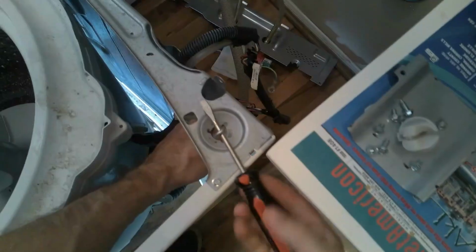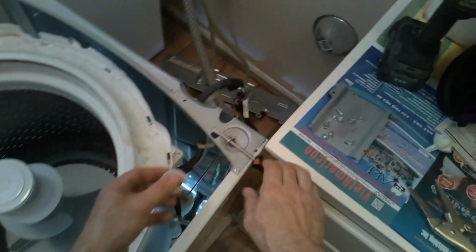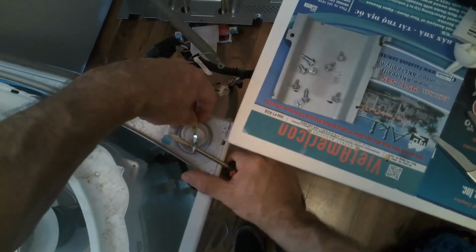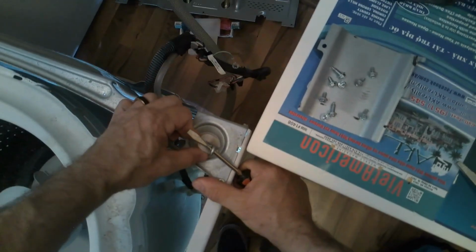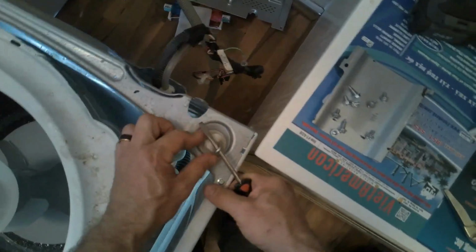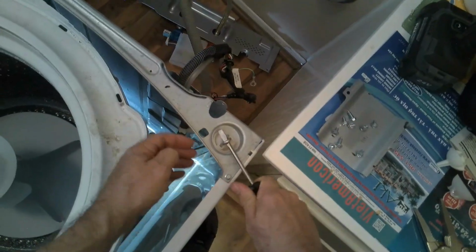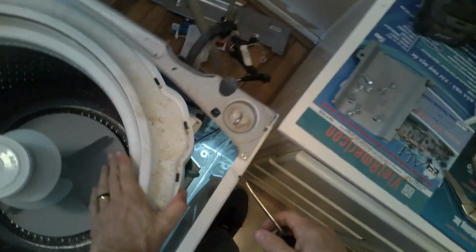But this is when the flathead comes in handy because it holds it itself. So now I don't have to worry about holding it. I can have my hands free, pry down and lip up under it. This makes it real simple. Then I can turn it around because these do have to clip into the little hole there. And then pull your flathead out and just tap it down if you have to with the bottom of your flathead.